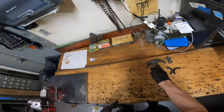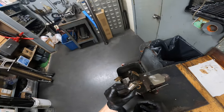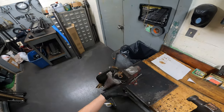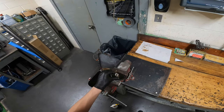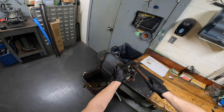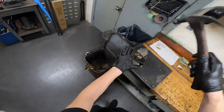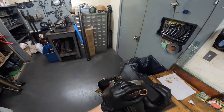Take a socket that matches the size approximately of your bushing — for me this is an 11/16 socket. Take a hammer, watch your fingers, and just give it a few good pounds to get started. The bushing should be level with the edge of the hinge. Your first couple hits are gonna matter here, so just set it on there, watch your fingers. As you can see, I already got it started, and a few good hits later it fell right out.